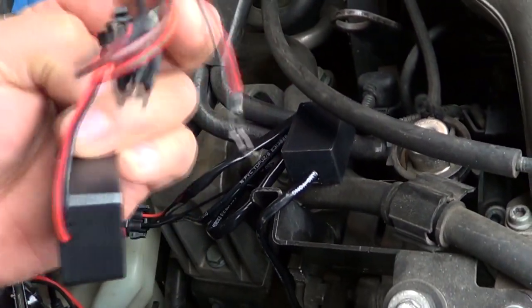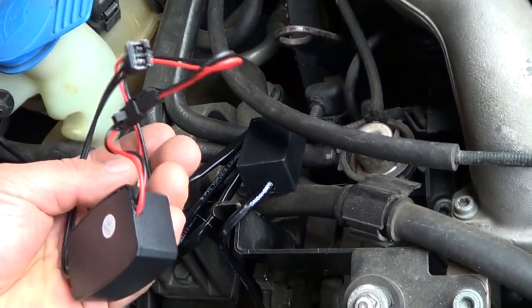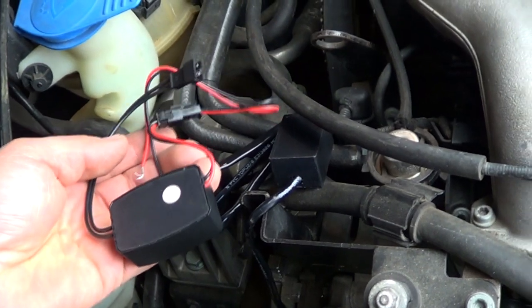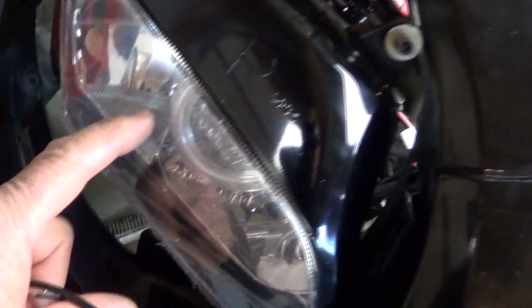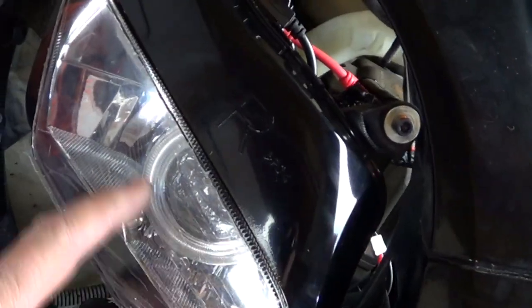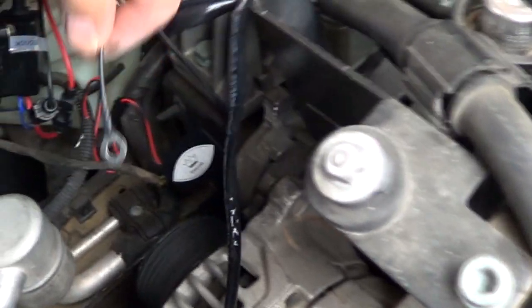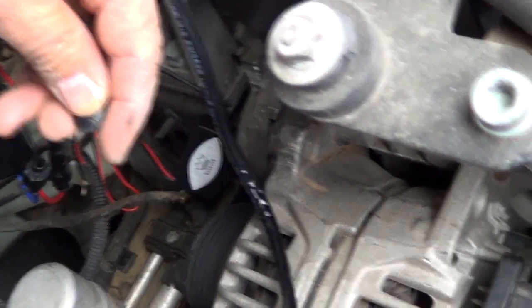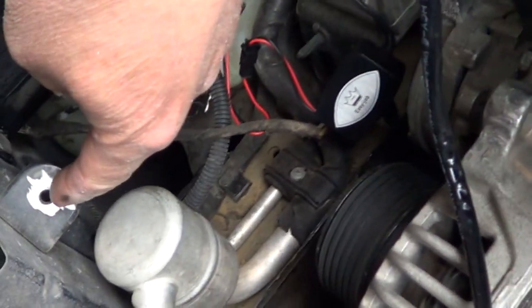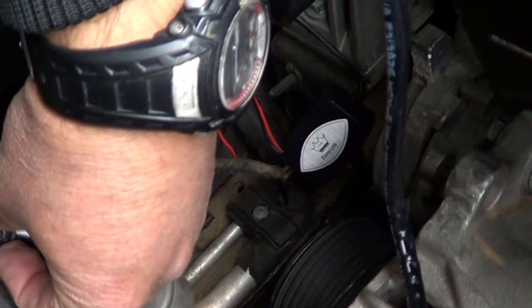The parking lights is what's going to power the red wire, and obviously the black one is going to be a ground. That way, when the parking lights are turned on, the halos right here — the green halos — are going to come on. That's what this is all about. For the ground wire, I'm going to use the OEM fastener right there. I ground the paint off right here so you can actually get a good ground, and it's going to be connected.